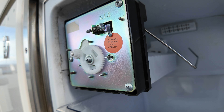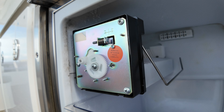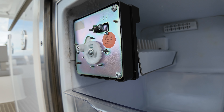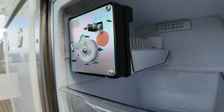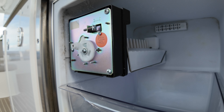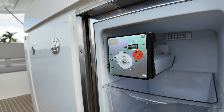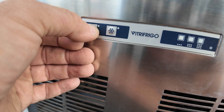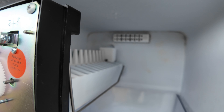There's no water in the tray. So let it reset. I want to hear the water start coming. It just kicked on the compressor. I do not see water flow. There's a possibility that the water valve is bad. Let's see if the button is working. But I didn't get any water flow into the ice module.